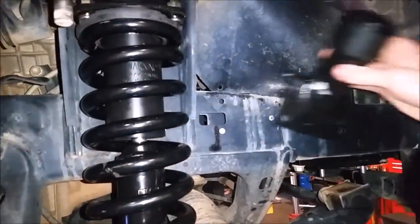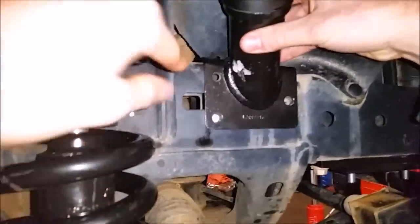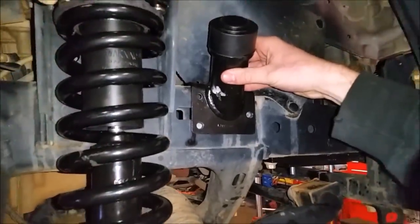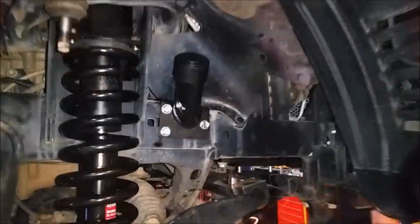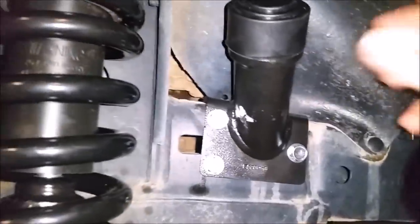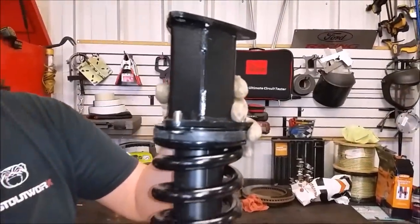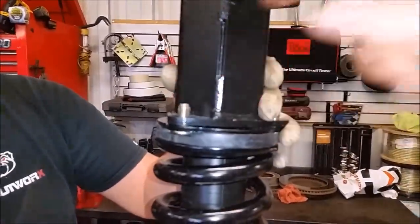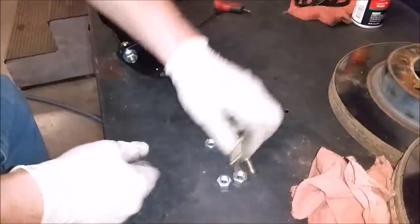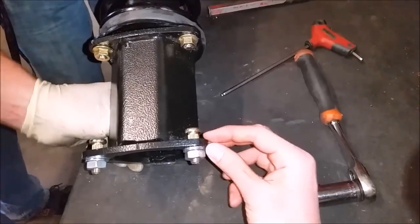We're now starting on the new bump stops. We've gone ahead and drawn two holes to where it'll be drilled through — there's already one already started in the frame — so we'll go ahead and drill through the frame and then install them. We now have the bump stop on, and the kit came with self-tapping screws for each side, so we went ahead and installed them and now that's right on. We're now assembling the new strut — we've got the strut spacer on there, and we'll just be using the original bolts that came right off of here to tighten this one down. For the top of the strut, we're going to use this piece that comes with the kit, and that's going to go in the top hole right there.